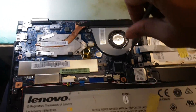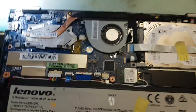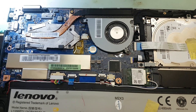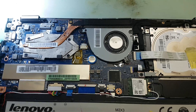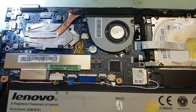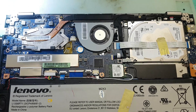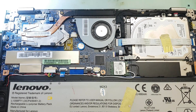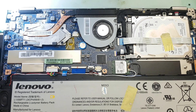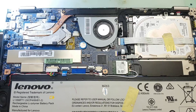Change the thermal paste. You may notice it sometimes gets stuck to the CPU and becomes a little difficult to remove, so when you pull the CPU heatsink, be very gentle and careful. That's just one of the biggest enemies that kills the laptop. There's another enemy we'll talk about — fake chargers — in our next video. Thank you, bye.